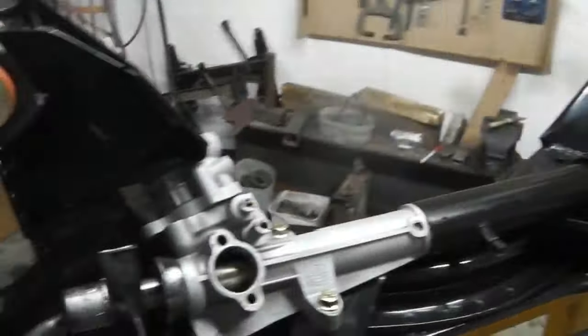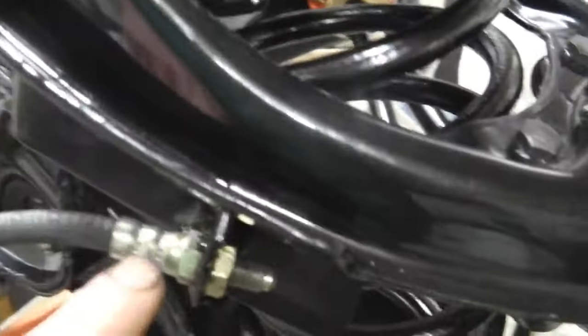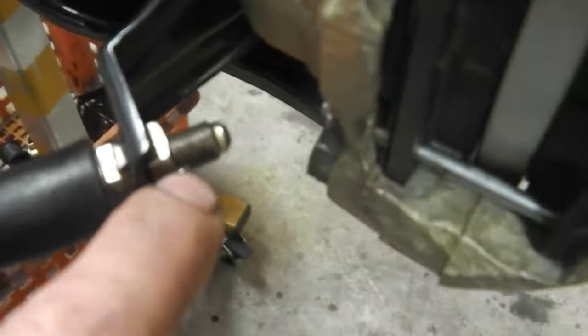The brakes, we've got one brake pipe. I need to order another one for the brake pipe. It slots into the back of those brackets which you fit here. And the brackets have little locking tabs so that the nut on the end of the brake hose, or the molded part of the brake hose, slots in and locks. Star washer and then the bolt on. Star washer and the bolt. And there's your flexi hose so that it can turn with the wheels. Racks connected up. We'll get that set up next.